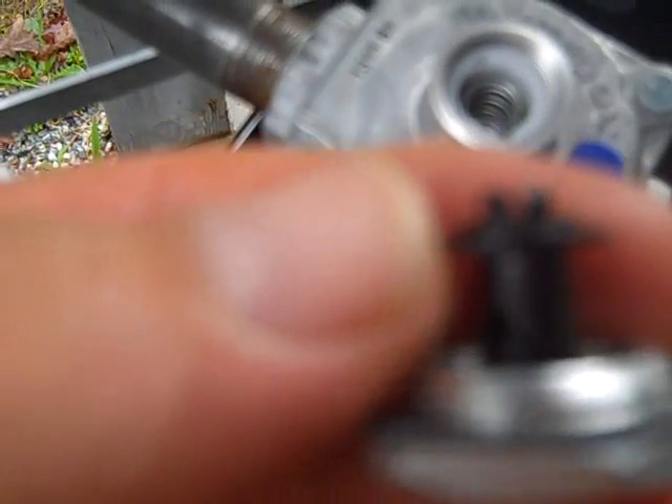We've got a propane range but it comes set up to run natural gas, so all the orifices have to be turned in — cranked in — to make the orifice size smaller, because propane has a higher pressure than natural gas. That's already been done. You also have to adjust the appliance regulator: there's a little plastic piece that you flip over, which pushes the spring down further, and that's how you set it up for propane.